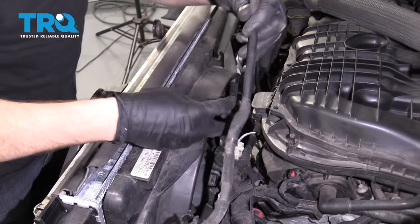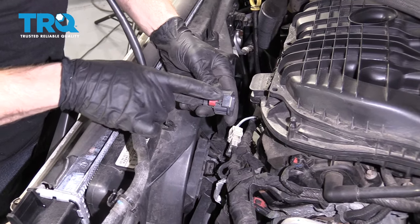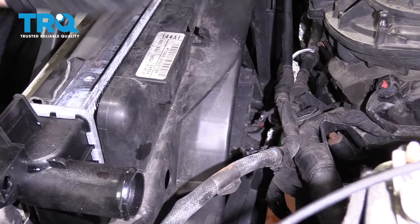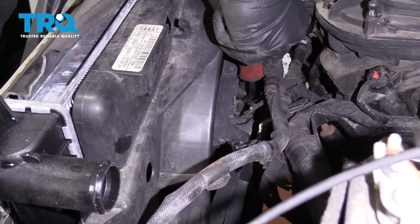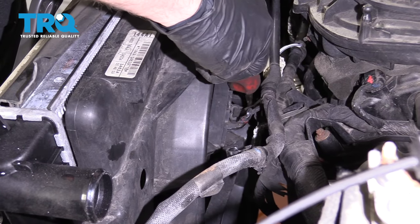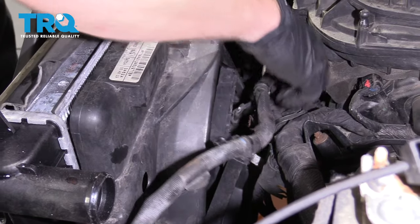It's time to get our wiring reconnected. Once you clip it in, make sure you slide this red tab down and lock it in. Make sure it's pushed all the way in — it's hard to get your fingers in there, so grab a small pry bar. It clicked. Take that red tab and lock it in. Give it a nice tug.